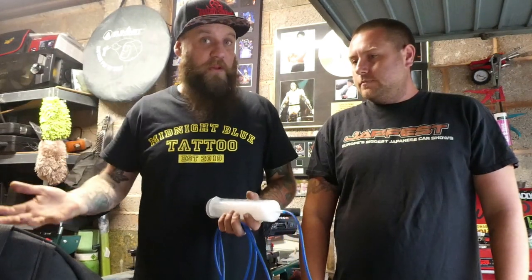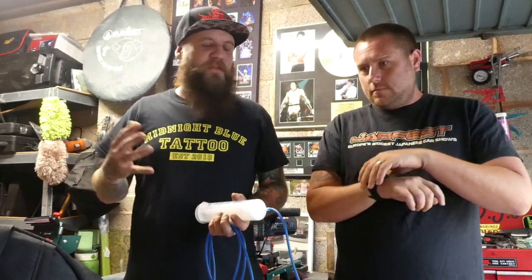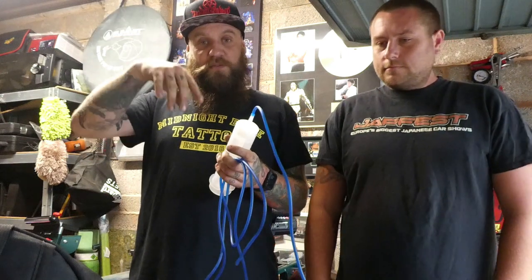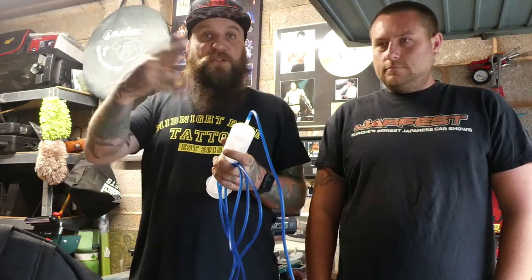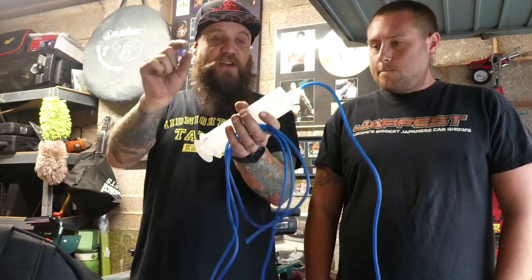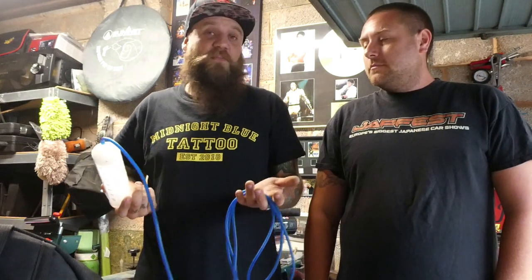What we'll do is, we're not going to go in from the engine bay above and pour it in like normal people would do. We're going to try and do it the easy way, because I'd have to take all my strut brace and everything out if we did that, because I can't get the airbox out. I struggle just checking the oil. Anyway, so what we do is we take the passenger wheel off, take a little flap of the wheel arch lining out, which is just two clips, and then right there should be the two bolts, the fill and the drain. Then we use this to fill. Should literally be that easy, as long as we can crack them. The hardest bit, I think, would probably just be cracking the nuts. Probably will be, mate.